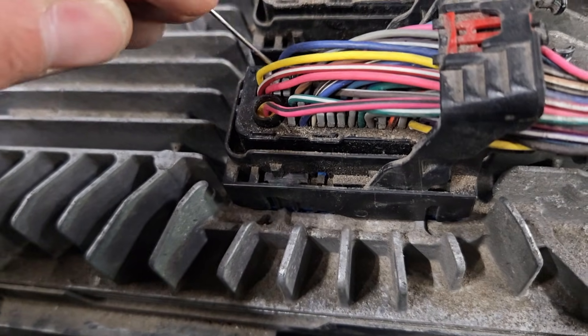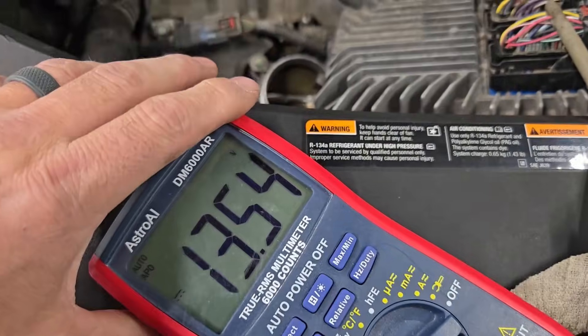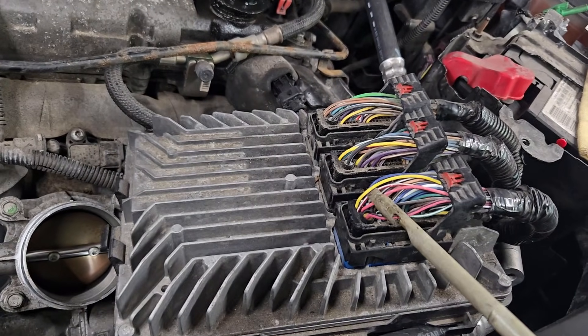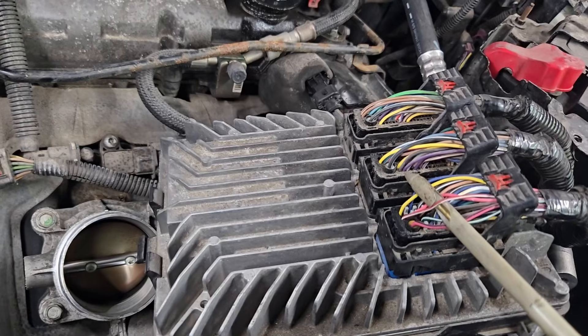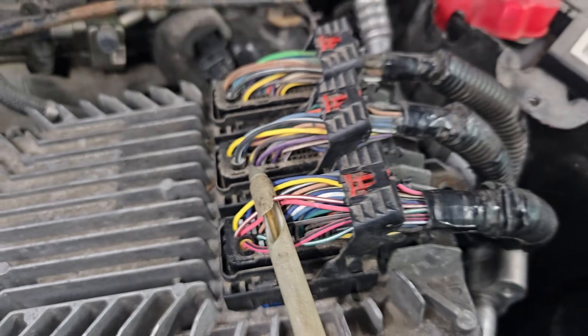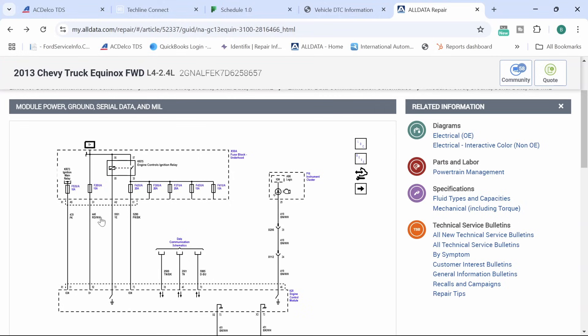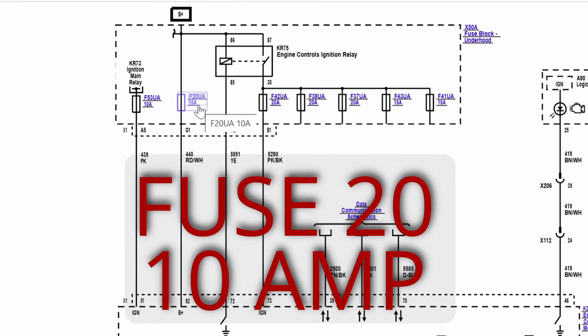The red and white and pink terminals are right next to each other, but these terminals are too small for the probe I have — I need to find another probe. We've got 13.5 volts on the pink wire at pin 51 — that's good. Now let's take a look at the red and white at pin 52 — this should also have voltage with the key in the run position. And what we got here: 2.5 volts. We only have 2.5 volts on the red and white wire.